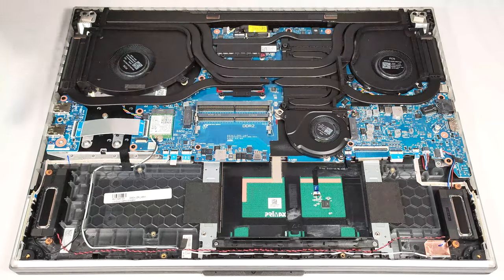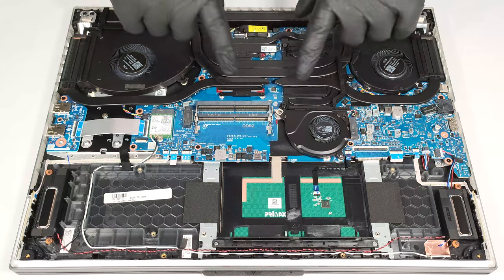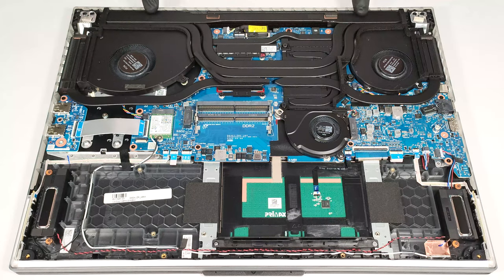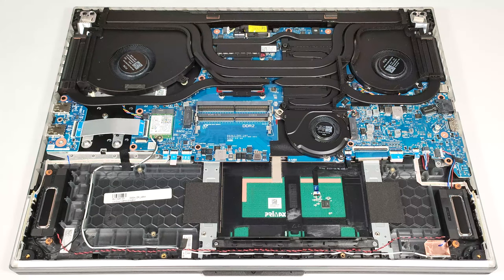The cooling is enormous. It features three fans — two are normally placed while the third one is above the chipset. Three heat pipes are shared between the CPU and the GPU, and there is one more for each chip. The small U-shaped pipe is positioned on the metal plate above the GPU, and it also cools the VRMs and the memory chips. Two of the heat sinks are on the sides of the fans, while the other three are top-mounted, and the one in the middle is very large. The smaller seventh heat pipe connects the metal plate and the heat spreader for the GPU. The graphics card and the processor are treated with liquid metal.